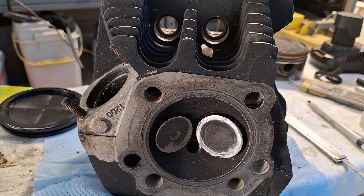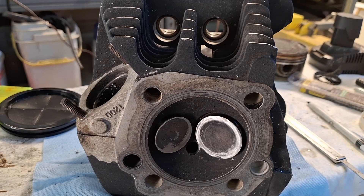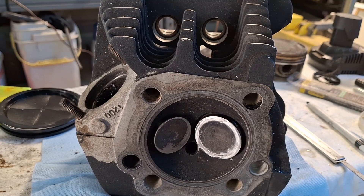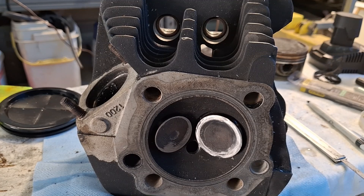That's the quick and easy way to check valve-to-valve clearance without any special tools or a fixture. Measure your stem protrusion, subtract your TDC lift, open the valve that much, then measure valve-to-valve. That's it in a nutshell. Thanks for watching guys, take care, have a great Christmas coming up, and have a great week — watch out for drunks on the road.